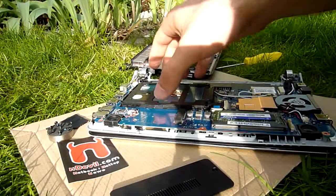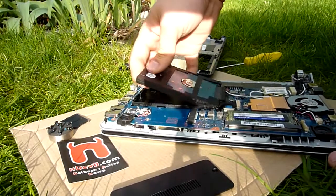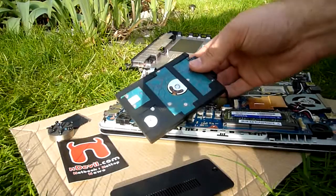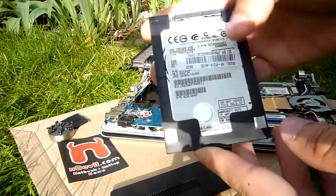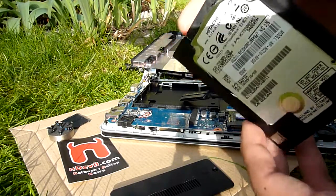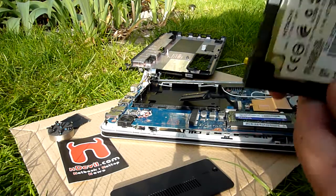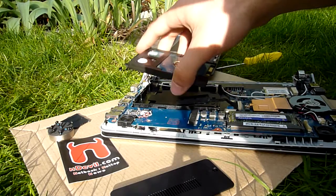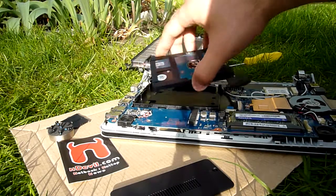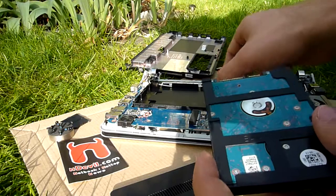For the hard drive, actually, you don't need to take out any more screws. You can just lift up the drive itself — it's only put in here and the rubber keeps it in place. And then you just have to unplug it. And there you go — you have your 250GB Hitachi hard drive that you can use for anything else and put in something more. This should be a 7.5mm height to the top, but there's enough space in here so you can put in a bigger, thicker version, I guess. So maybe even a terabyte is possible, but then the rubber won't fit anymore.